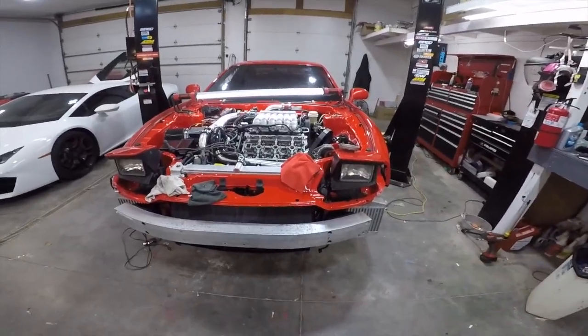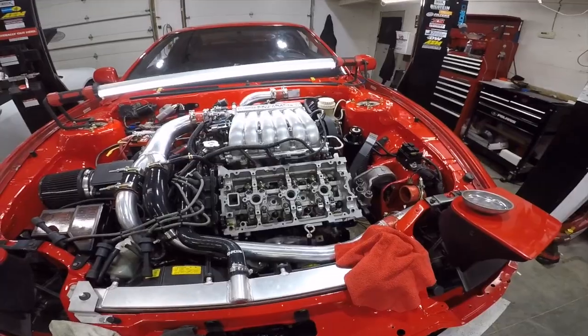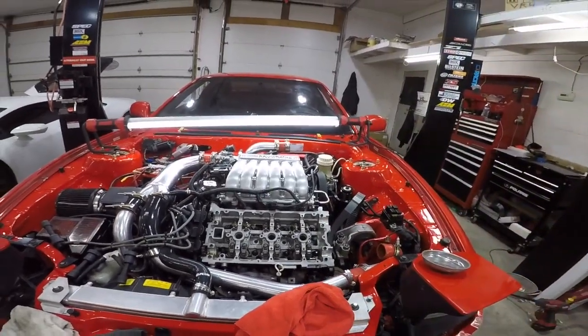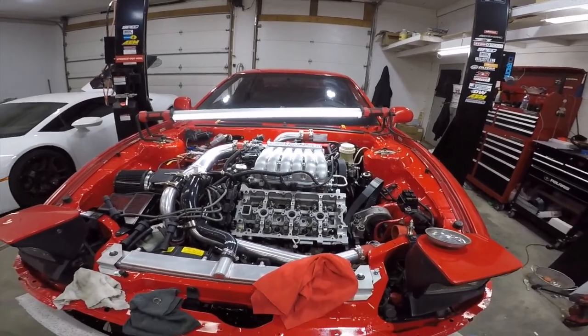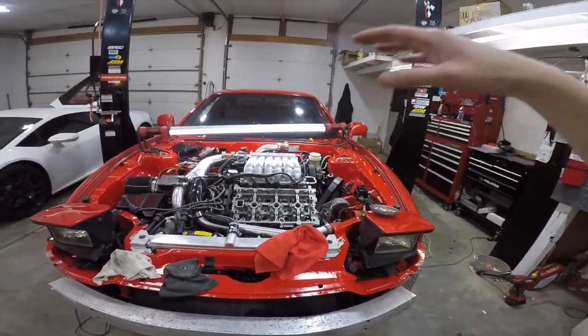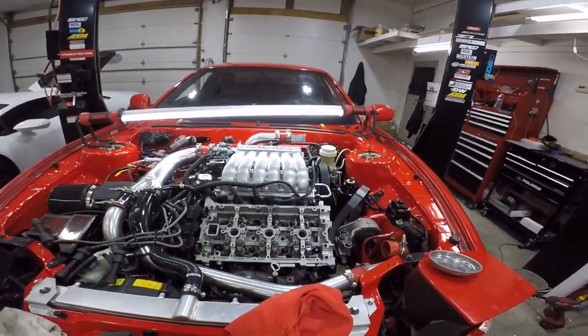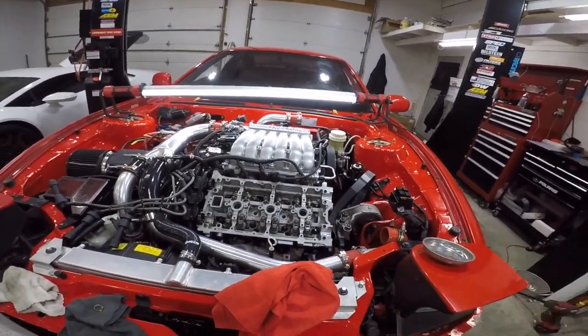I really think that a piston ring is in upside down with the amount of blow-by that I've been getting, and I think it is. I think it's pressurizing the crankcase. I think they have at least one of the piston rings in upside down because it just pressurizes the hell out of the crankcase to where it just blows smoke out of the valve cover. Like exhaust smoke. It's crazy.